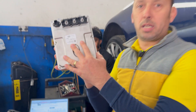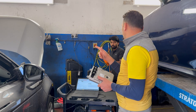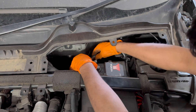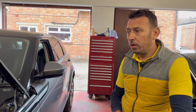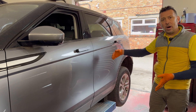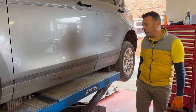This is how the part looks, and it is fitted under the car where the mild-voltage battery is also fitted. We're going to get up on the ramp and disconnect the 12-volt battery so we're ready to go. Being a mild hybrid, the 48-volt battery — unlike high-voltage systems — doesn't have a service plug, so we can work on it pretty much straight away. The battery casing is quite a big long thing, with control units and a lot of wiring.